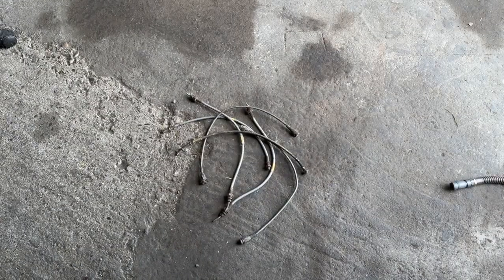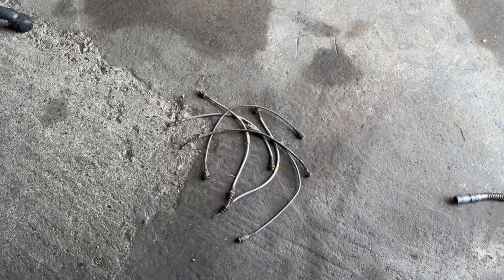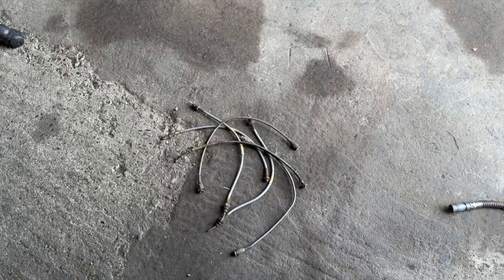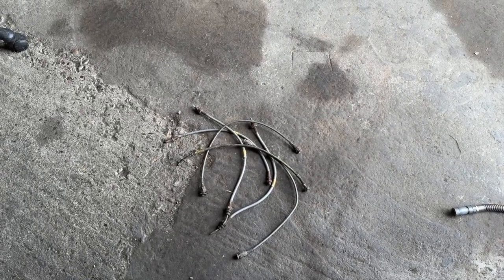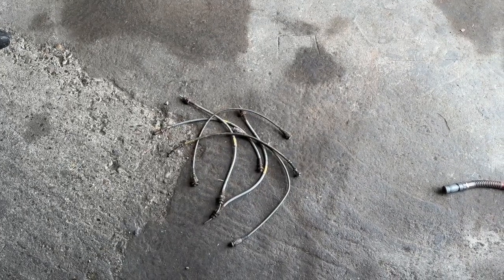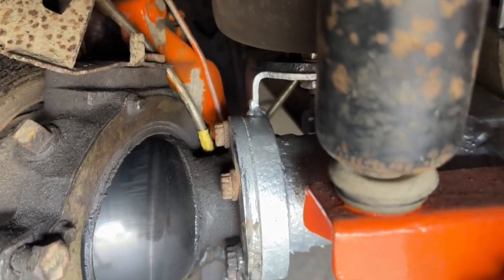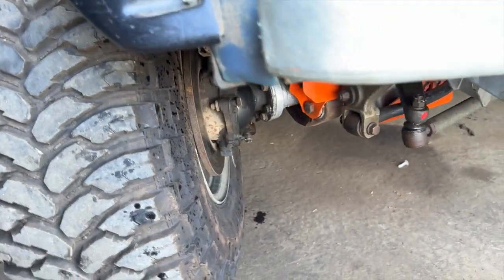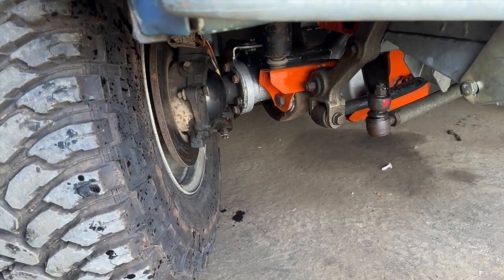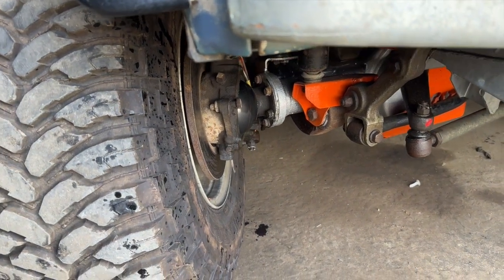Let's get it off. Just got into my stores and found a selection of different braided brake pipes, so at least we haven't got to order any. So I'm going to pull it in, jack it up, and see if we can get this changed and work out if we can secure it from going anywhere near it somehow. So when it's on full lock, when it's aired out, it catches. We need to do something about that. We may have found another cause — it's caught behind that brake pipe. When you air up, it's getting caught behind there. Bit of a design flaw. So I need to rectify that.